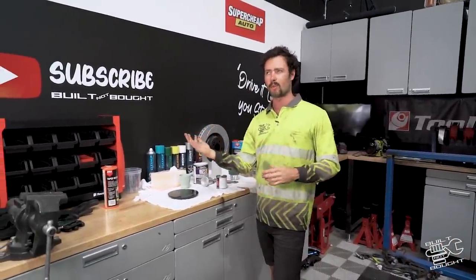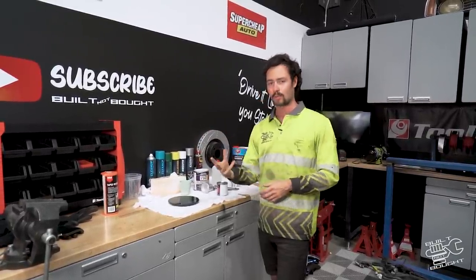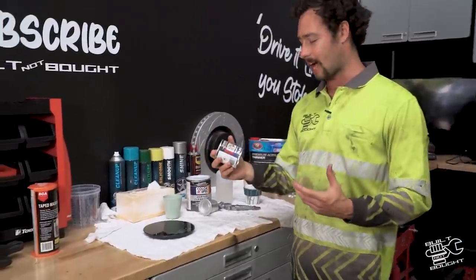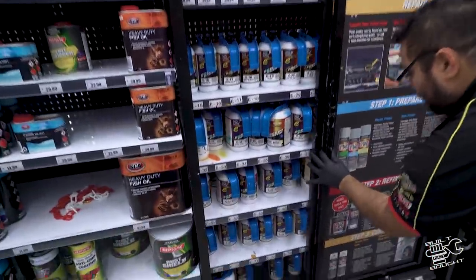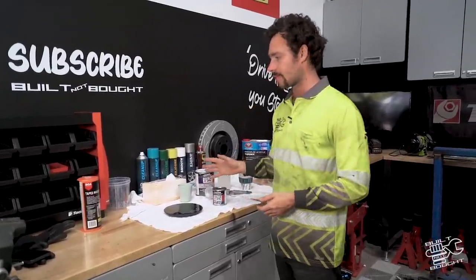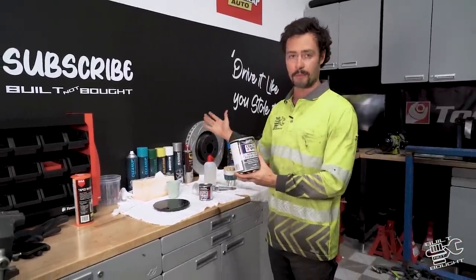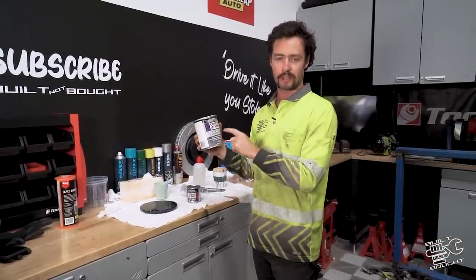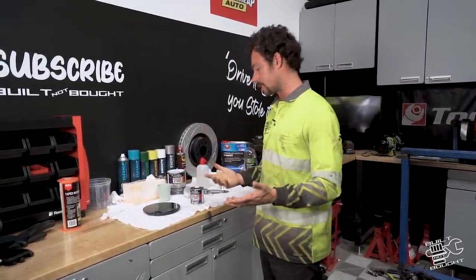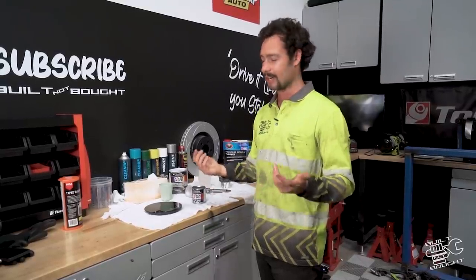I've just scuffed it up with 180 to 320 grit, not gone right through to the metal, so it kept a bit of that base coat. It is white underneath, which will help this colour pop. I'm doing a gunmetal grey, so it will cover nicely being a darker colour. This was just pre-mixed at Supercheap - you can go in and colour match. I just made this one up on the spot. A few coats - maybe two or three - then we'll finish with acrylic clear coat, roughly one part clear to one and a half parts thinners. Once you do a full coat of clear, that's the finished product.